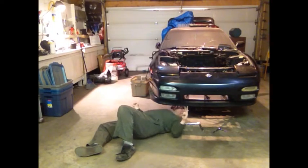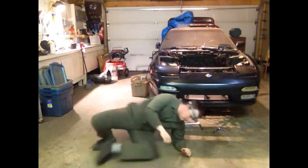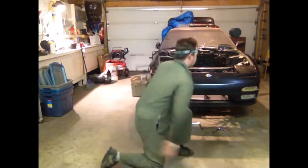It looks like there's a couple 10 millimeter nuts on each side too that kind of go up into the fenders, front left and right fender. Here, bear with me here, I'll try to show you. I'm gonna go down in underneath the car, and I don't even know if you're gonna be able to see this. We'll try here. There's the camera angle. You can't really see what I'm filming, but if you see where that spotlight is, there's one there, another one there. So we'll take those off,